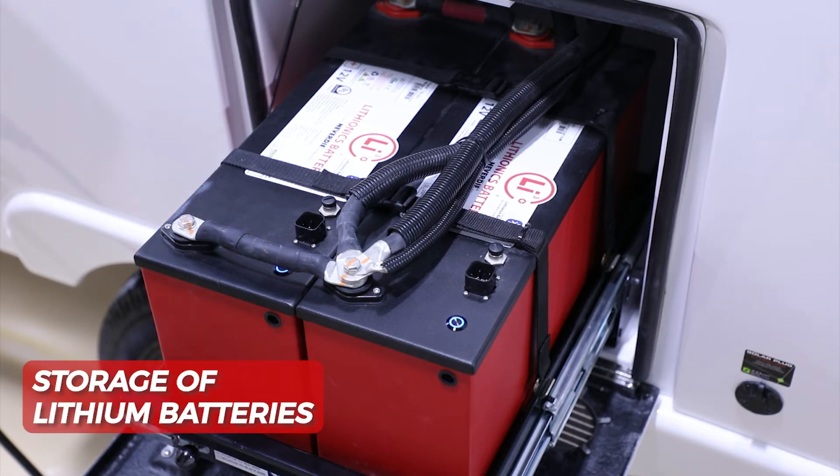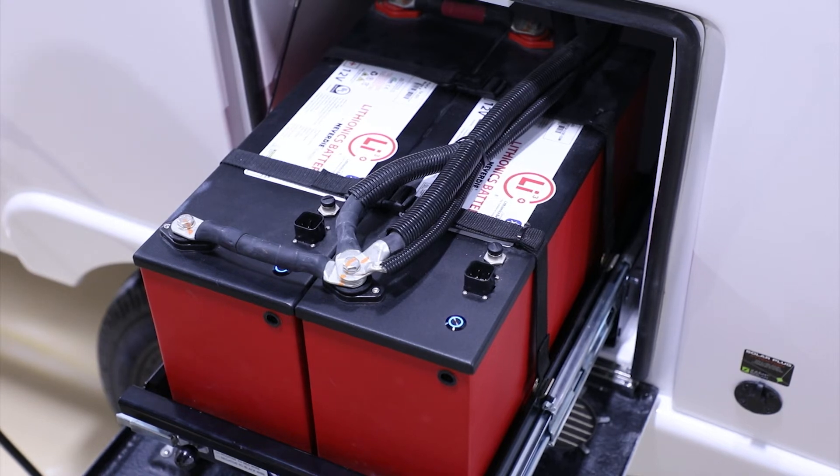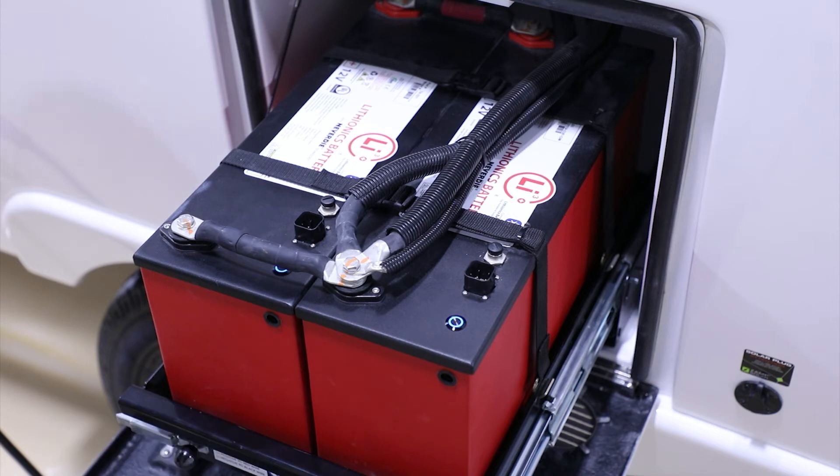Now let's talk about storage. For any lithium battery, they typically recommend discharging the battery to about 50% and then turning the battery off. There is a 12-volt breaker inside the camper, however it does not disconnect all of the loads. Keep in mind that weather conditions also impact battery discharge even when it's not connected. While sitting at 50% state of charge, you'll want to check on it occasionally, and if it's in storage longer than six months, you'd want to go back out, fully charge it, then discharge back down to 50% before storing it again for up to another six months.